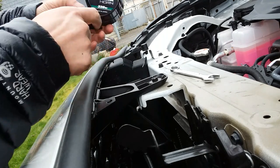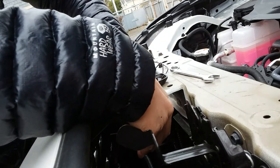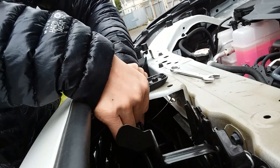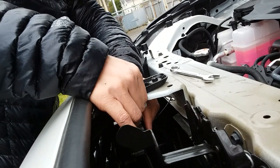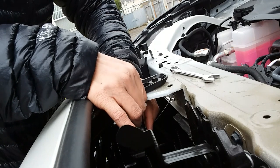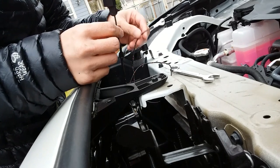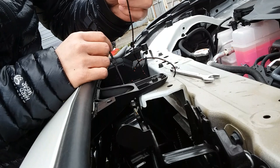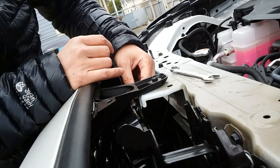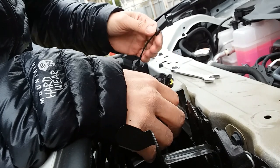I'm going to put the 330 Hertz horn on the left side, using the same bolt — stick it right up in there and just hand tighten it for now. The reason I'm hand tightening it is because I need to put the ground cable right behind the bolt before I tighten it with the wrench, so it's touching bare metal. There are two cables: this is the power and this is the ground.